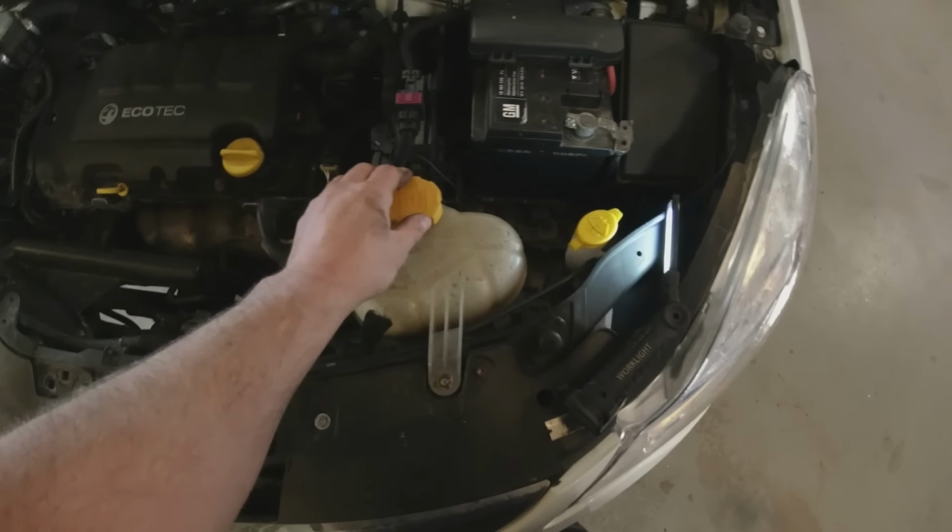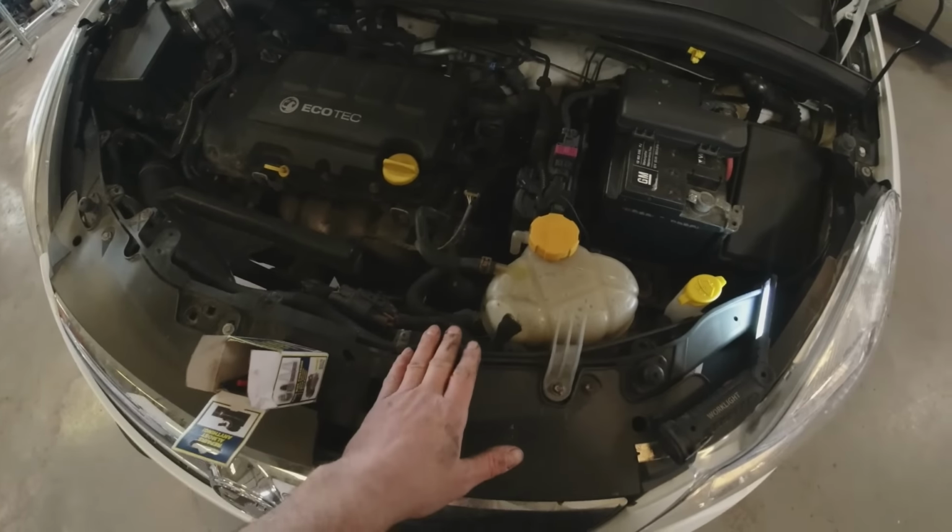So you can see it looked like this water bottle was knocking around. And when I first drove the car and heard the noise, it sounded to me like something in the engine bay was knocking against the bodywork. So I'm hoping that's what it was. What had happened is someone had previously glued the clip in and it had fallen out. So that was falling forwards and it was able to knock against this quite a lot. So I used the soldering iron to melt the clip back in again and then reinforced it with some of this stuff, which is actually quite rate. It's a powder you put on and then put a super glue mixture over the top, and now there's no movement in the bottle at all. So we'll put it all back together again and take it for a drive, and hopefully that's what it was.